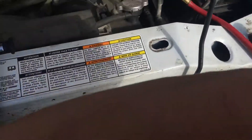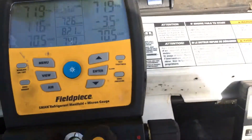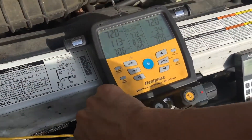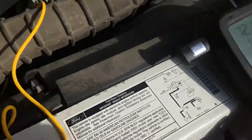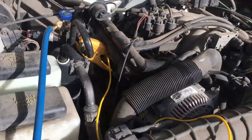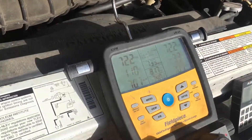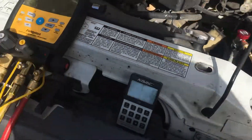I'll close off the vacuum — we got down to 120 in the lines. There we go, we got 71 psi. The temperature out here is roughly 77 degrees, and they told me this car has been sitting since this morning. Whether I have one drop of liquid refrigerant or 100 pounds in the system, if it's roughly 70 degrees you'll get roughly 70 psi. R12 was more one-to-one — at 70 degrees you had roughly 70 psi. R134a is just a little bit more.